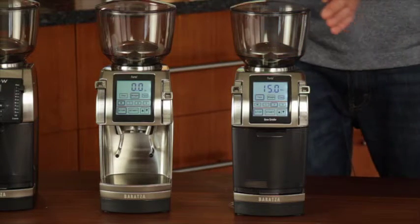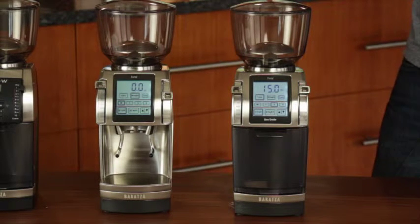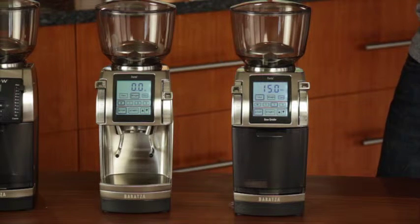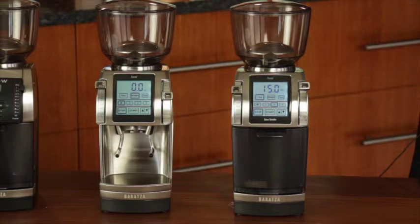Shifting our attention over to the Forte BG, it's called the Brew Grinder because it is equipped with Ditting steel burrs that were designed to produce an excellent consistency coarse grind without sacrificing the ability to grind espresso fine. Due to the fact the BG was designed with manual brews in mind, it does not come equipped with the metal porta holder, although it is an accessory that will fit. Again, it has the shutoff hopper, the metal adjustment arms, and the same touchscreen display with grind by weight and grind by time options. The grind speed of the Forte BG is 1.2 to 2.4 grams a second.